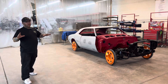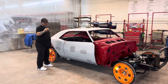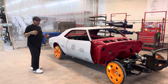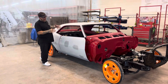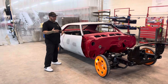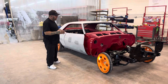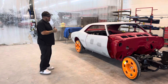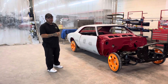Jeremy Luna's Camaro has started some controversy over the use of body filler — people seem to think we're building a car out of it, when really if you look at our videos we're like maybe three sheets of paper thick. We don't believe in using primer as a filler — it shrinks back. Long story short, we've gotten through the body process and we're now doing jams. We're ready to partially assemble the car so we can spray the red. This particular red is super sensitive — one coat difference or a dry time difference made the red look completely different, and it's not even a metallic, it's a solid. To play it safe we're going to loosely assemble it and spray all the red at one time, then take it back apart, re-sand it. Later after it's completely assembled we have to do black stripes, so it'll come apart again — interesting process but it takes a lot to get it done right.